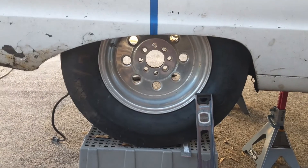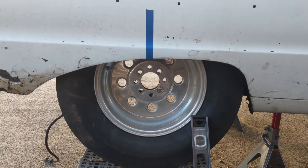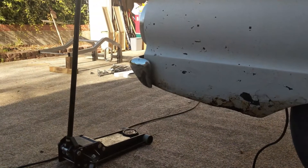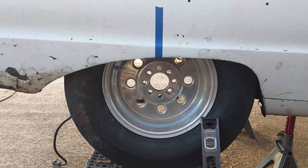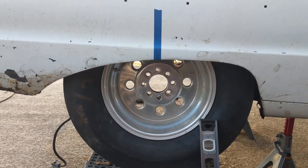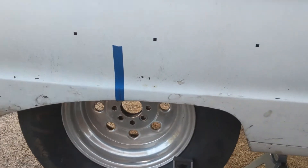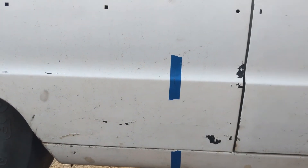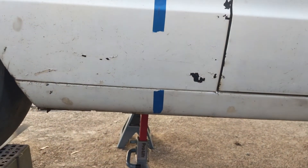The time-lapse you just watched was me figuring stuff out. So that's going to be the centerline of my axle. If you look at my four-link, I just mocked it up — I need to come 26 and three-quarters inches forward, and that's where the front of the crossmember on the four-link setup will be. I measured from there to 26 and three-quarters, which is the mark there. I don't have the car level yet, but once I do, I'll transfer that measurement.